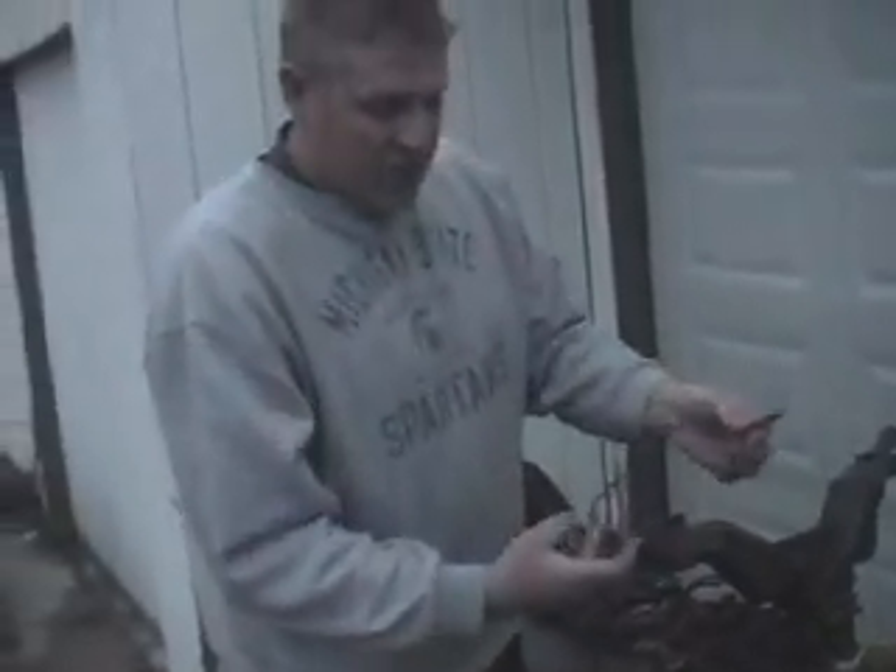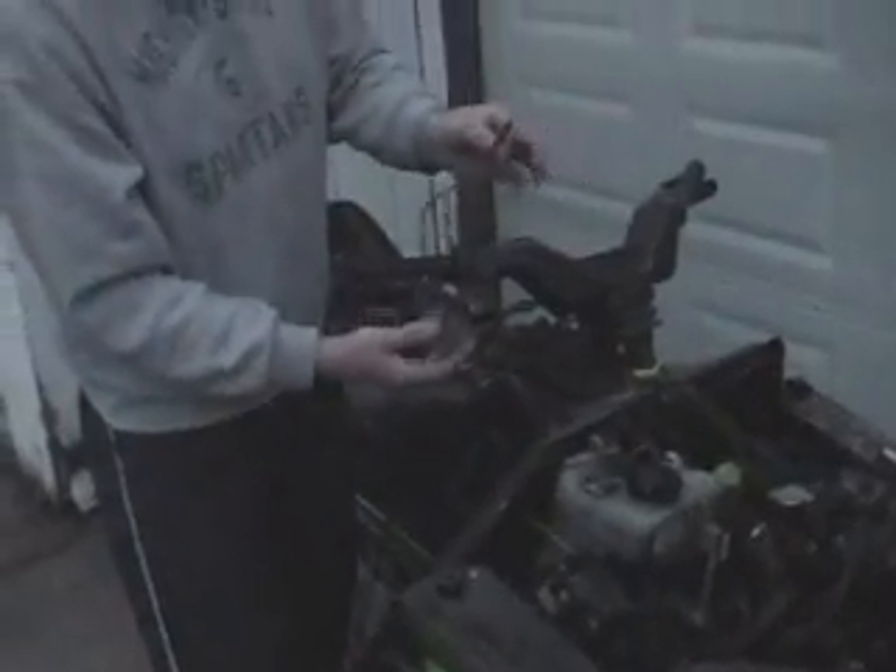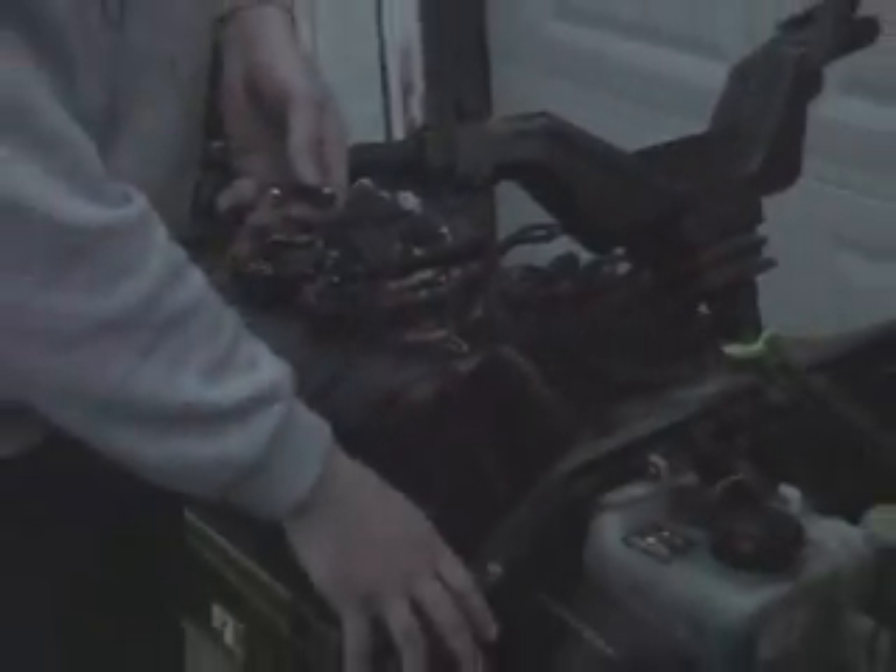Now the next thing you would want to do is check the voltage going to your regulator. You can see the regulator on this sled is right here, but the plug is back in here a little bit. Essentially you've got different plugs for these stators — two plugs, three plugs, four plugs depending on your sled, model, and year. You just do the same thing you just did: plug the harness back in, and you've got the plug going into the harness coming to the regulator. Just unplug that, take your probes, stick it in the plug that goes into your regulator, start the sled up, measure your voltage, and make sure the voltage is getting from the stator to your regulator. Some regulators are on this side, some are on the firewall, some are on the footwell — you've got to look around and find your regulator.